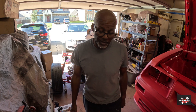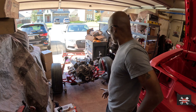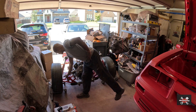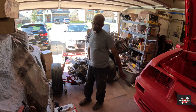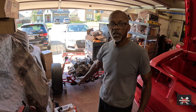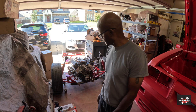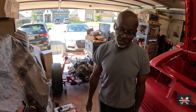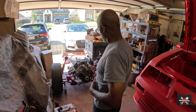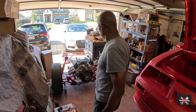All right y'all, so we're on step five. I put some wood in there to keep these two from collapsing, because if this was a coil spring I would have the spring in there and it would have kept it straight up. But I'm doing coilovers in the front, so we have to do it like this - and I'm by myself. Let's see if we can work this.